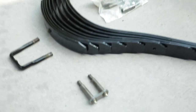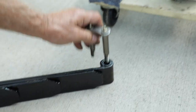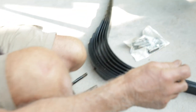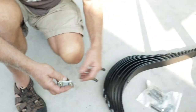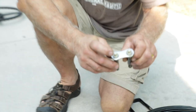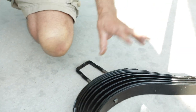Everything's ready to just bolt up. We've got a rear spring, which is a 10-leaf spring. We got new shackles that'll go into the locations on both sides, and we've got a frame spreader to spread them and put them in place. We're using modern grease fittings instead of the traditional ones — a lot of people are doing that just to make it work better.